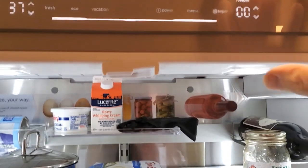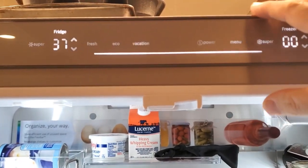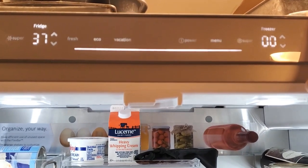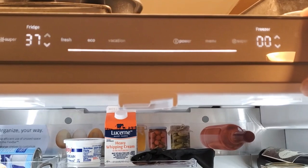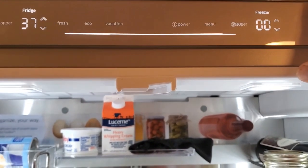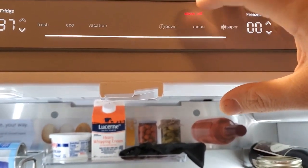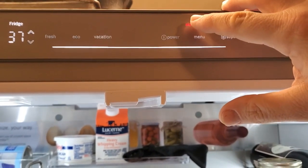Here at the top, right now you can see there's nothing lit up for the alarm button. But in showroom mode, the alarm off button is lit up in red. The way that you turn this off so that it is no longer in showroom mode is you turn the refrigerator off, give it a couple minutes, then turn it back on. As soon as it comes on, you want to press and hold — there it is, because I've got the door open, but it would be solid red.